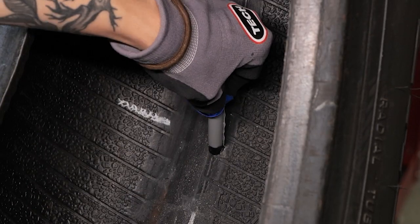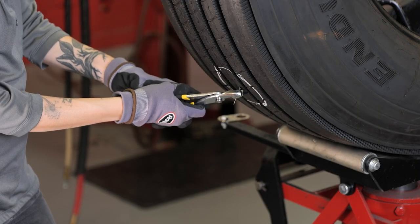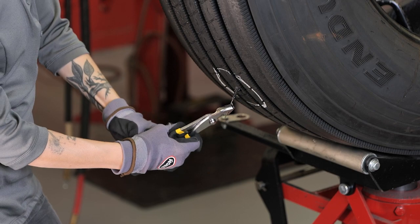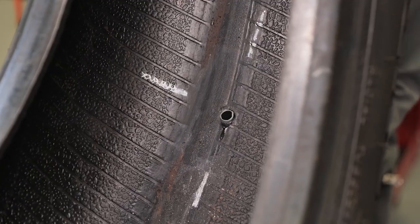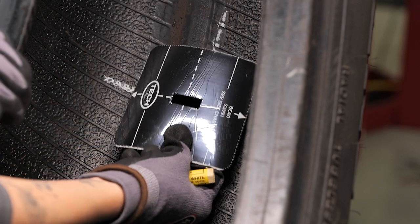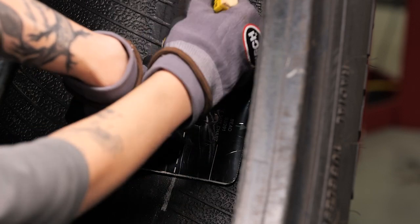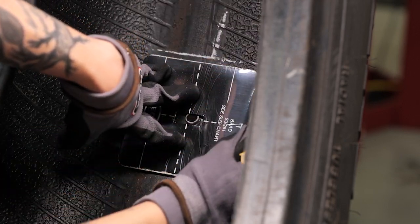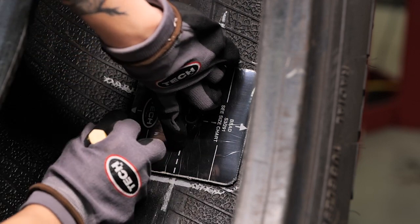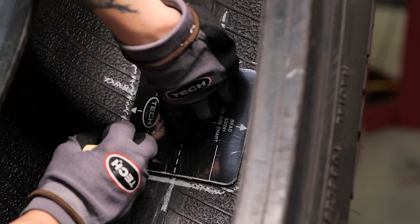Insert the lead wire through the injury. Grasp the wire on the outside of the tire with pliers. Pull the stem through the tire until approximately an eighth of an inch of the stem remains above the inner liner. Now place the appropriate template on the inside of the tire on the stem and, using a tire paint stick, trace around the edge of the template. If no template is available, freehand trace half an inch larger than your repair unit. This line will serve as a guide for mechanical buffing of the inner liner.